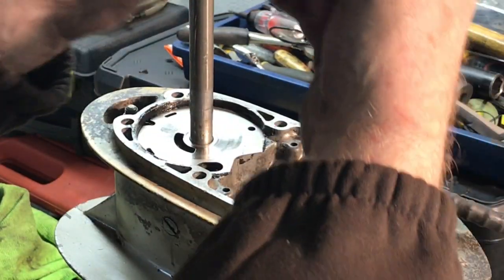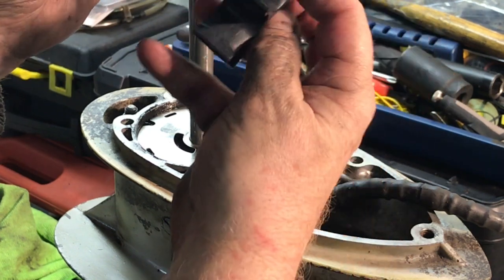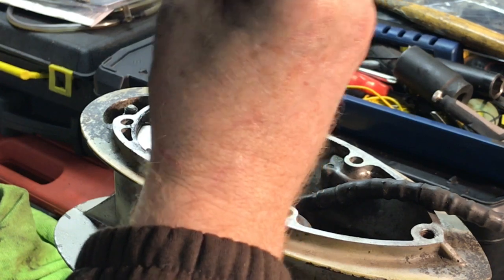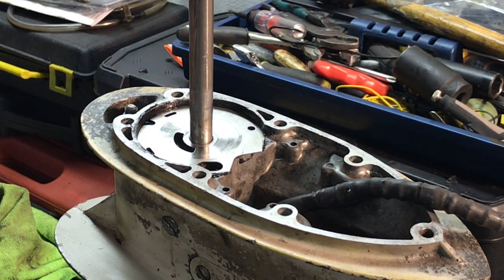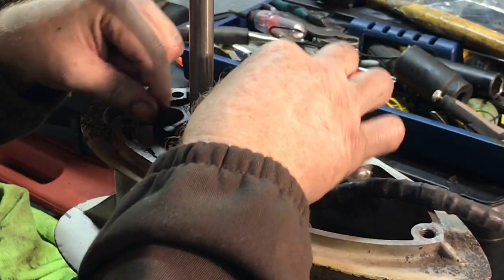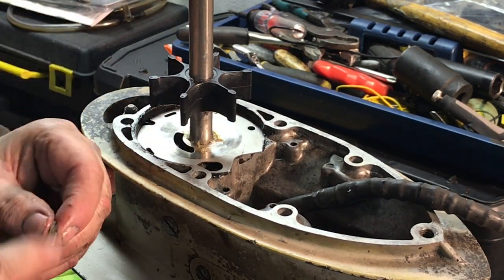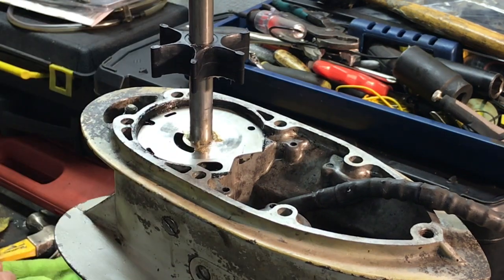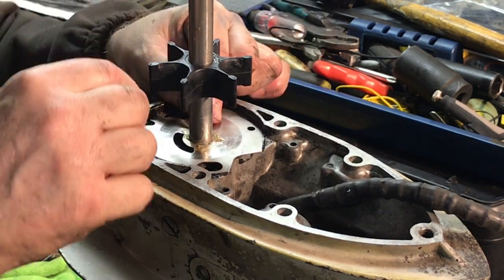You can see — this one's new, this one's the old one — and you can hardly see any wear on the tips of the fins. A little bit there maybe, but it ain't in bad shape. I'm going to replace it just because these do seem a little stronger, but I'm going to hold on to the old one as a spare part, just in case. I don't think it matters which orientation this goes on. I've got to put the woodruff key in — put some grease on this.